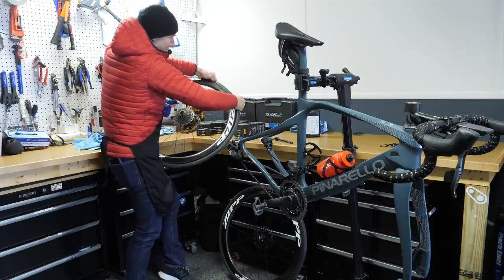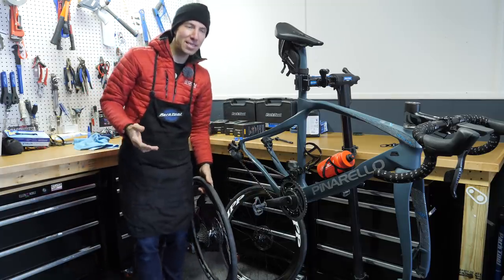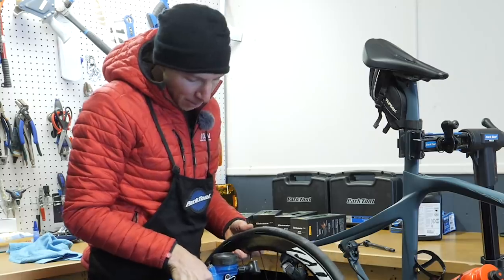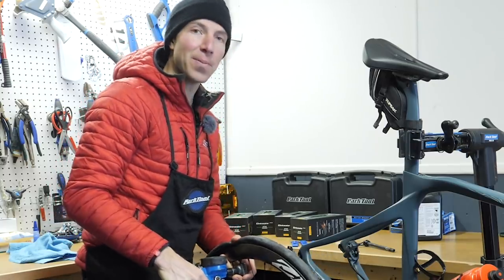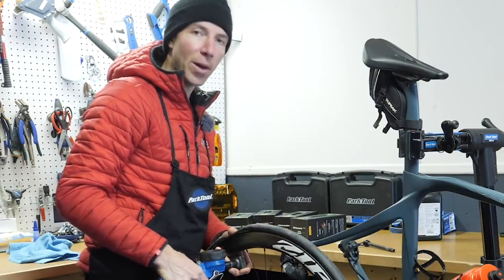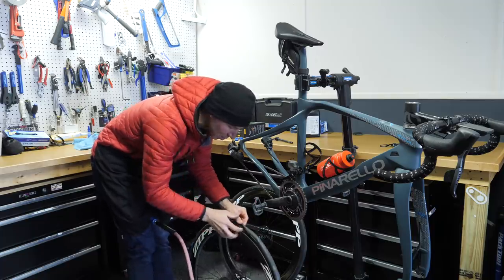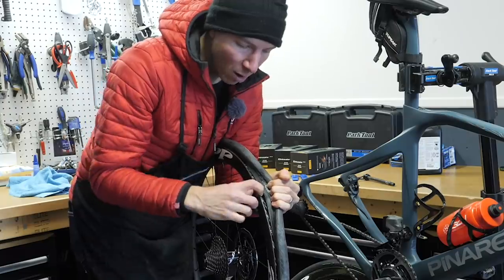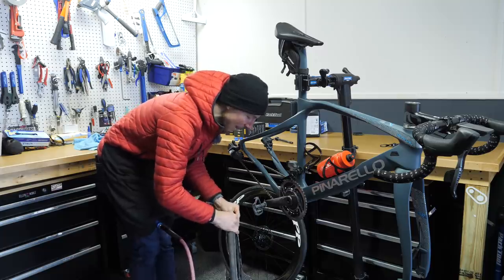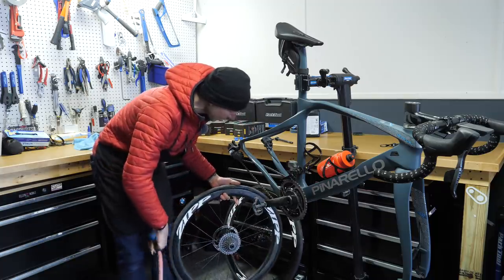My logo there is at the top, and I'm able to just snap this on without a whole lot of problem. I grabbed my compressor so that I could just pop these right on. However, if you use a regular pump, that should not be a problem. A lot of manufacturers of big pumps have big bore options where you can push a big amount of air all at the same time to really get these tires to seat quickly. If they're not going on, you always want to take a look and see where that might be happening. You can also do a trick where you take the valve core out and blow a lot of air in even faster to really get them to seat up well.